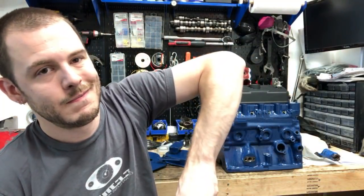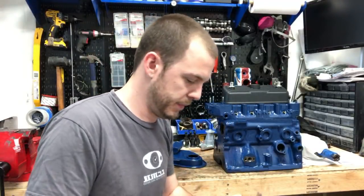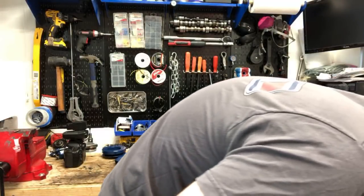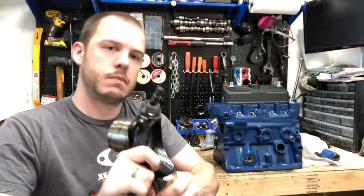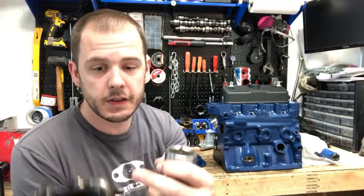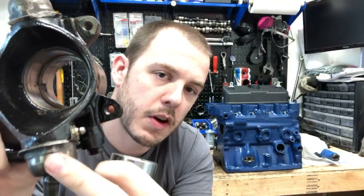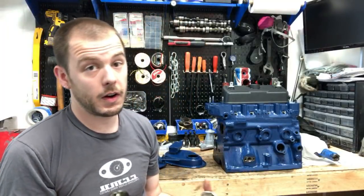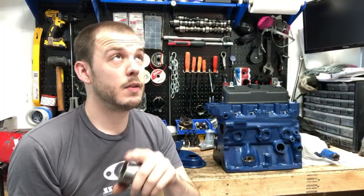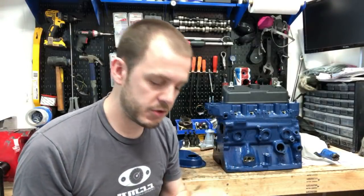Let's see. Okay, that's definitely tight. Damn it, why did I tighten that? Well, there's a shim that goes in right here, in between this and the washer. Just take one of them out, if there are any in there. If there aren't any in there, wait, you said it got tight when the spring goes in. Add shims. Got that mixed up. Add some shims.